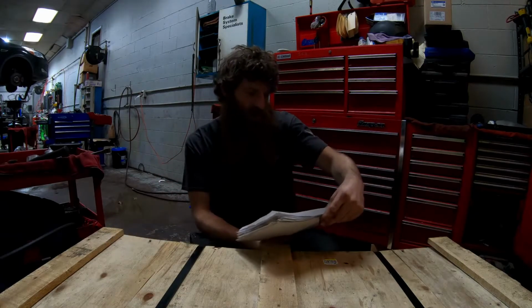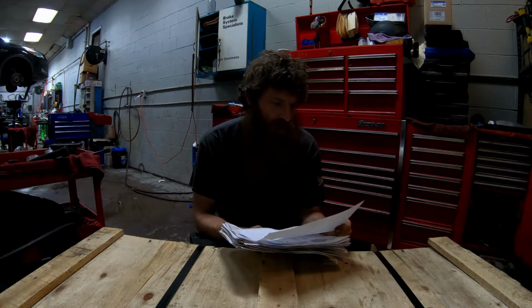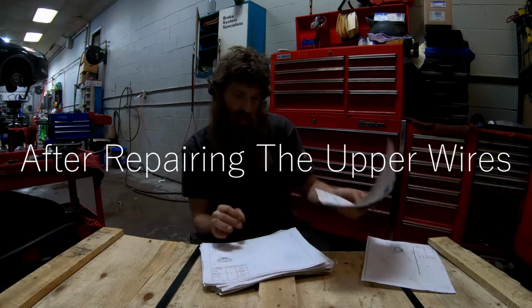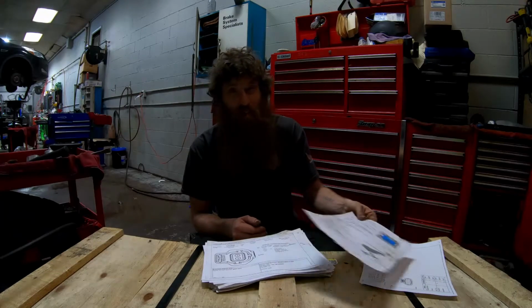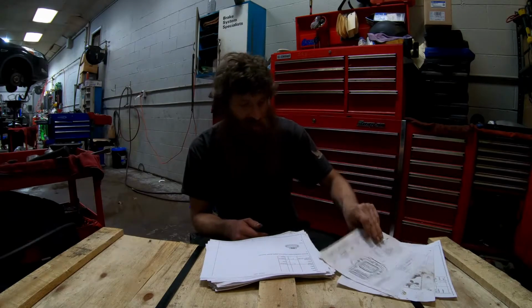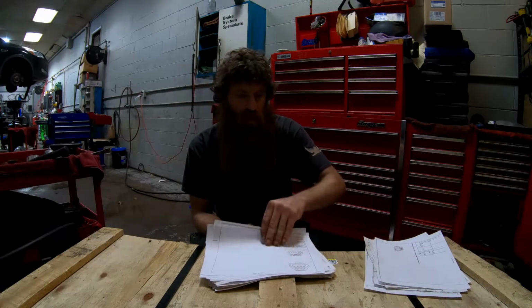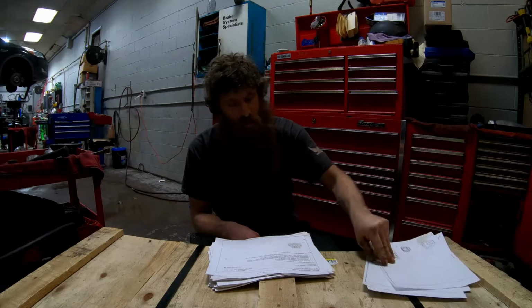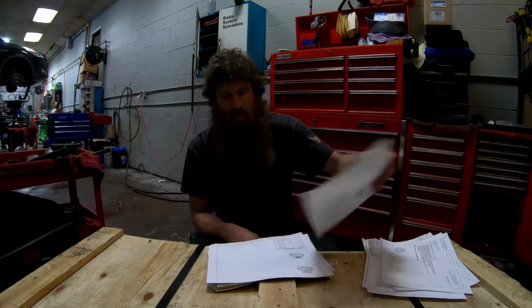Alright, now I'm going to talk about this Ford truck a little bit. So when I first got it, the code that was coming back was a VREF code. And I started checking this, that, and the other thing. I ended up finding 9 volts coming out on the 5-volt reference for the VREF circuit. And so we sent it to the dealership. They put a computer in it, told us it needed an APP. Bring it back here, we put an APP in it. I gave it back to my dad because it seemed okay. 3 days later, it comes back. Same thing. Hill assist light, traction light.